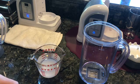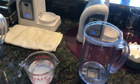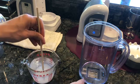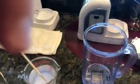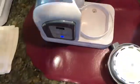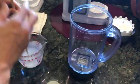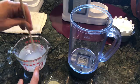So it's about 60 grams of citric acid. Now we have it in there, but I'm going to want to mix it — I'll grab a little wooden chopstick because I want it to dissolve first in the water before I pour it into the pitcher. I want to caution you: do not put citric acid in the machine part of the unit, and do not put any citric acid on the bottom of the pitcher. This is strictly going to go on the inside only, and this is not a normal cleaning so I'm using way more citric acid than I would normally need.